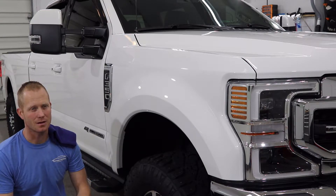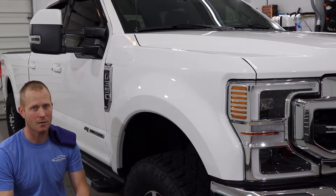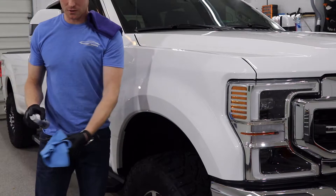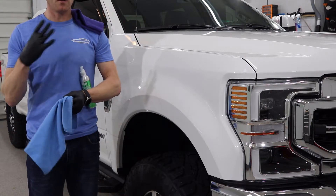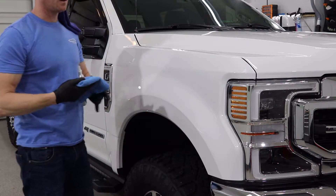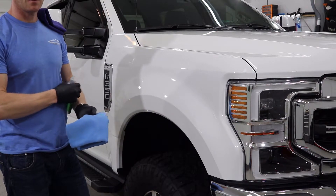The biggest thing when applying CanCoat or CanCoat Pro especially indoors: number one, we always turn off any fans or the furnace so there's no air circulation, in case there are other cars in the area and it settles on them. We always try to point the cloth away from the vehicle when spraying — that'll help minimize it. Then at the end, once you're done doing the whole vehicle, get a brand new cloth and gently wipe the whole surface, just in case anything settled on there. What that'll avoid is a rough texture to your paint.